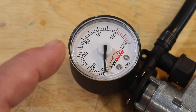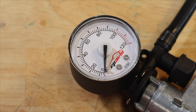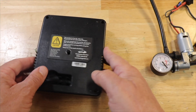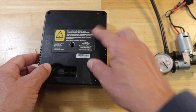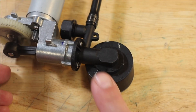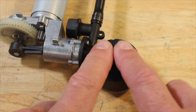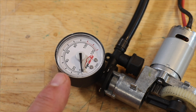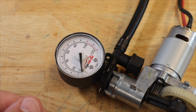I really had to leave the air compressor valve gauge on there. The reason why is the way it stays connected to the compressor is through the use of the case — the gauge just fits right in there and the clamshell is on top of it holding the pressure gauge into this base. You can see a little bit of glue there; I just glued this to the manifold. One of my experiments will be to pump it up high and see if this gets blown off or not.